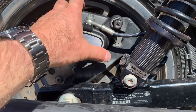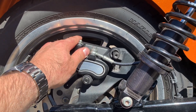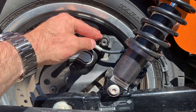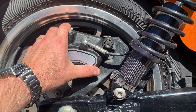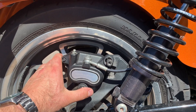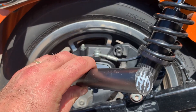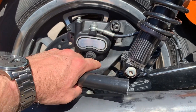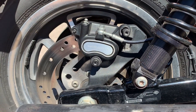So we're going to fix this so I can make it functional and pass the roadworthy test to transfer the bike into my name. I called up my local engineering plastics company and said I need to make a bush for a caliper that can slide on it — needs some lubricating properties. They found an off-cut of some plastic bar stock, so I'm going to machine a couple of bushes to fit in these locations on the caliper and take out all that movement.